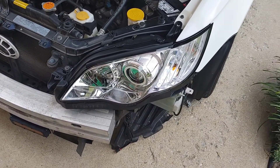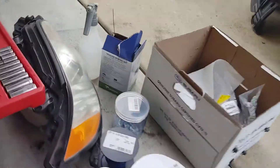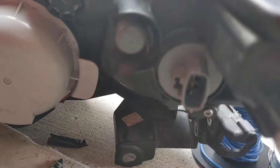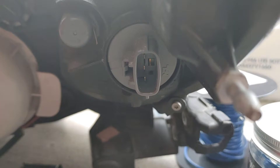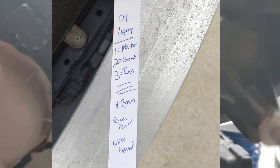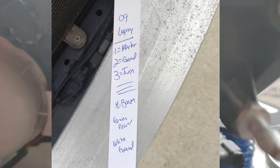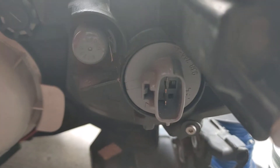For the 09 Legacy, if you look on the back piece that goes into your turn signal, there's three lines. On the female end, there's going to be a side that says one, two, and three on the actual fob that goes in there. One is going to be for your side marker, two — which will be the middle one — is going to be your ground, and three is for your turn signal. We connected into all three of them for the halo, and I'll post a few pictures of the actual thing I'm talking about.